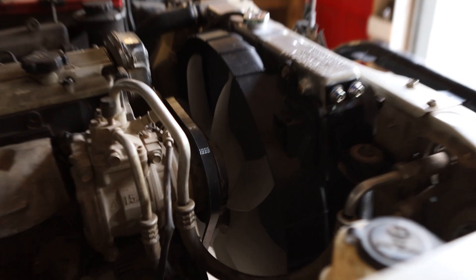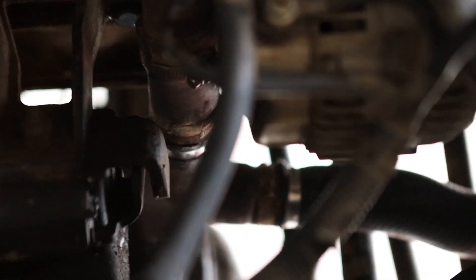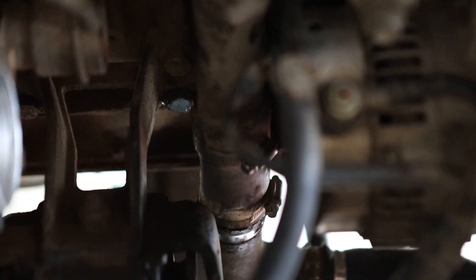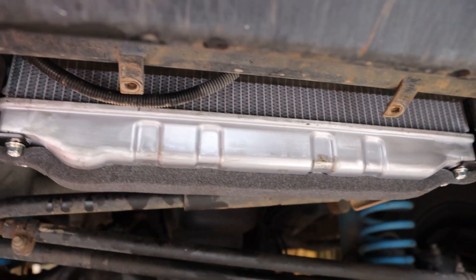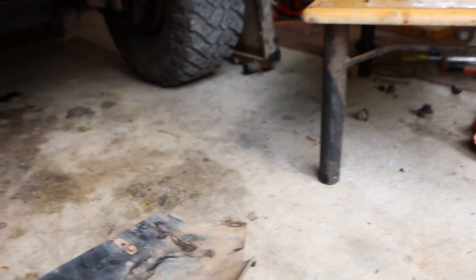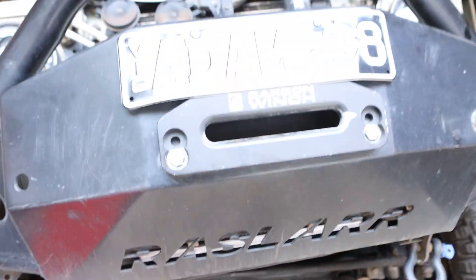It is a new day — got a bit done last night but didn't finish it off. The radiator, fan, and shroud and everything is all bolted in. Thermostat is in with all the hoses. I had to modify the thermostat housing to make it work with the endless air because the pipes had to run a different way, so there are lots of joins in it — not ideal, but it will work. Because this is a bigger radiator it hangs down a little bit lower than the other one, which is just inevitable. This is the original guard that would go under there to stop stoning, and this is the new one — it's only plastic so it's not a bash guard, but I think I'd have to try pretty hard to smack a rock on that.